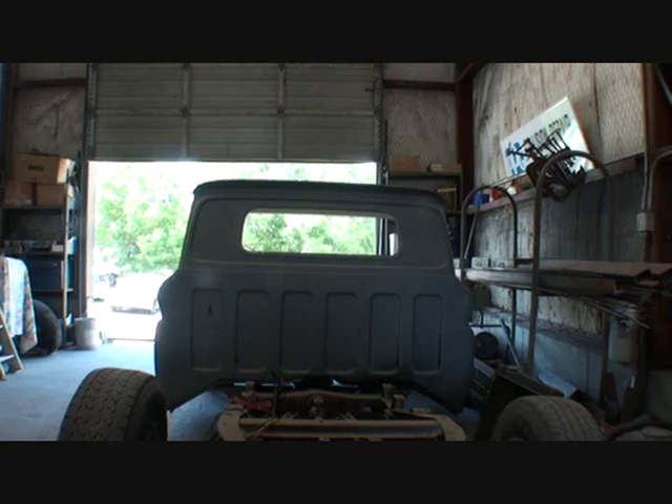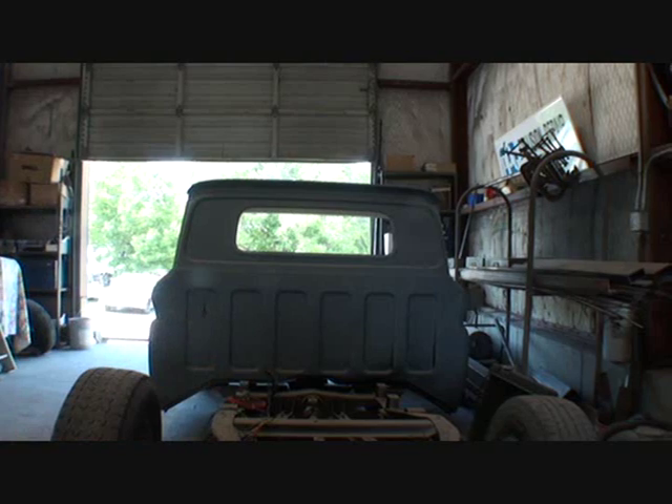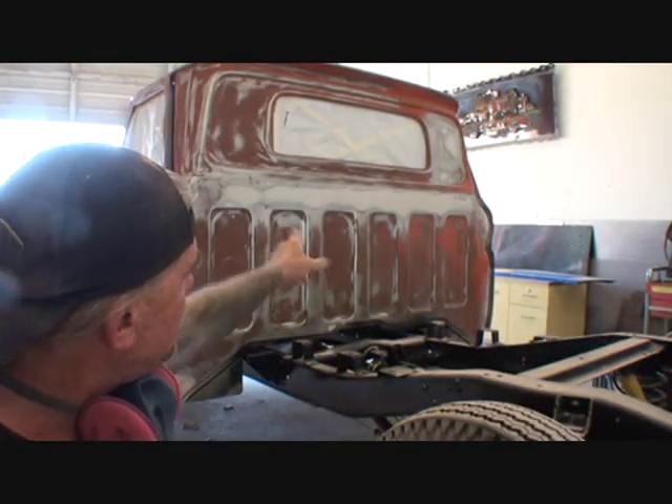Let's say you strip it to bare metal and put your epoxy primer on it — like this truck right here has been stripped down to bare metal and we went ahead and put epoxy primer on it to seal it. Well, that's basically what the old factory original paint did. This was a single-stage paint at the time — I believe it was an acrylic enamel over lacquer primer. If you look beyond the primer and the paint, you can see the metal is in very, very good shape and it didn't need to be stripped down. If you have a vehicle like this that still has the original paint and has never been painted before, you might consider doing this instead of stripping it to bare metal and wasting your money and time.